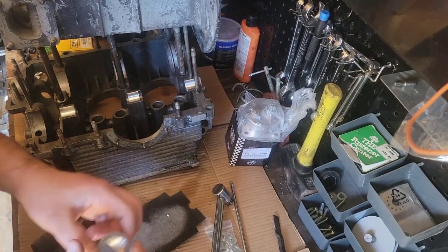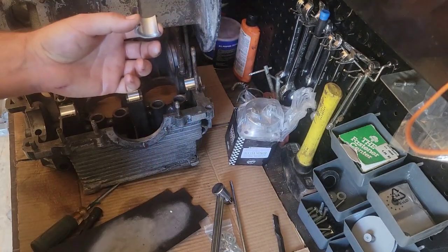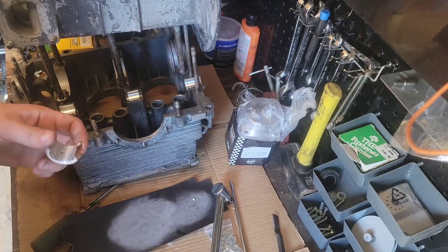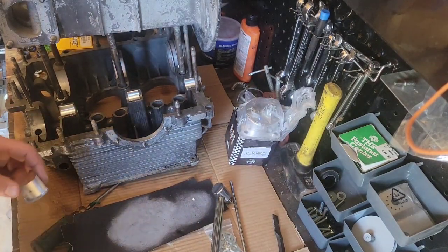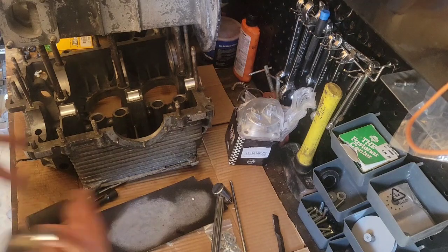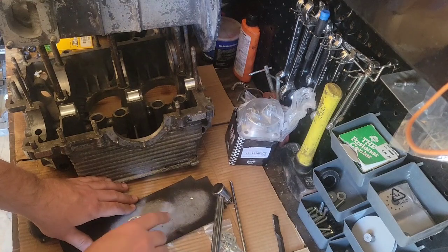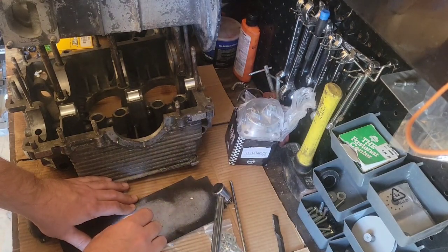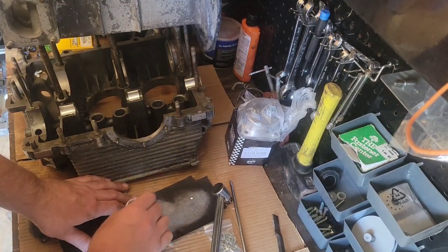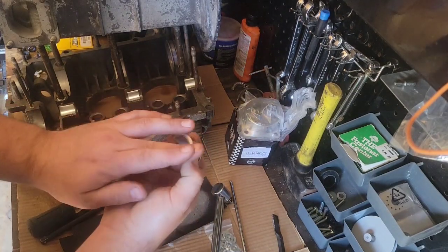is on your camshaft thrust bearing, you have that flat lip on the outside. After there, have some sandpaper. You put oil, pretty much of any type. I think I put some two-cycle mix oil on there. You can use thin motor oil, penetrating oil, whatever you want to use. But you take your flat surface, put your sandpaper on it, lubricate your sandpaper. Then you scrub your bearing on it in a circular motion. That'll wear down that surface right there as evenly as possible.